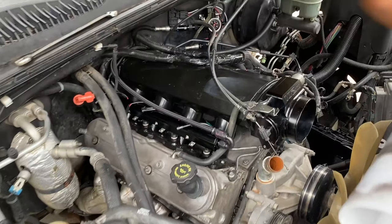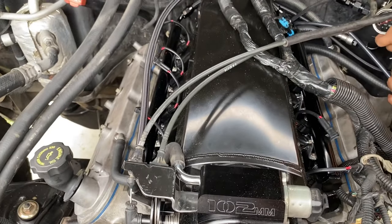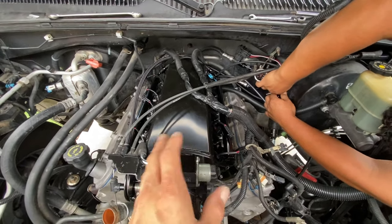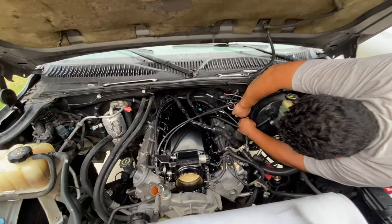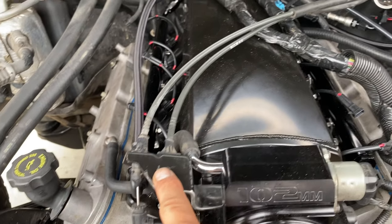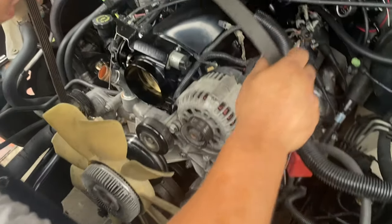We're pretty much almost done - all we really have left is wiring up that E85 sensor, adding the fuel filter for the E85, and then soon we'll be able to start her up. We went ahead and threw in our new spark plugs. We got our fuel rail back off to exchange for PTFE hose for E85. Got that new line on, throwing our 180 hose all the way around into the one that feeds the rails. All we have left is wiring up the E85 sensor and figuring out a better position for the throttle body. Got the alternator on, about to get this serpentine belt on. Appreciate you guys for watching - like, comment, and subscribe.